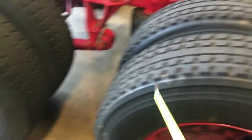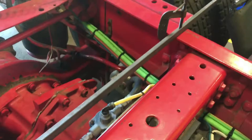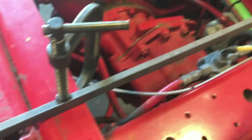The last measurement is how to measure the thrust of your rear axles — essentially checking if the axles are cocked. I use about a nine-foot piece of angle iron clamped down. I measured equal distances from the inside of the frame on both sides, then used a speed square to set it at an exact 90 degrees, so it's perfectly true and straight to the frame.